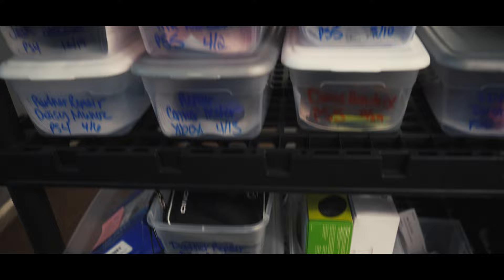Got some repairs over here that we're going to go through and get fixed up. A lot of these people send us a competitor's controller — sometimes they get stick drift fixed. We do a lot of stick drift fixes: we replace the board, thumbstick modules, put a stick drift kit on it, and get those potentiometers back to absolute zero so you don't drift in the game.